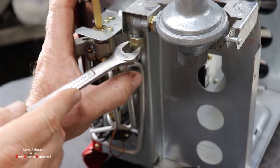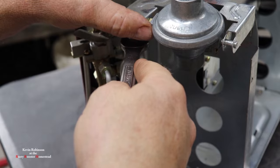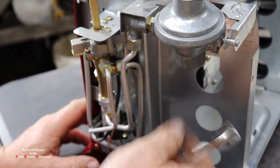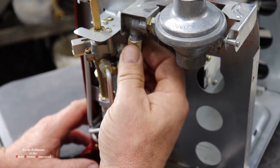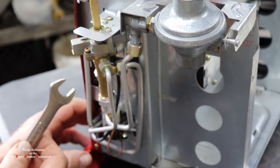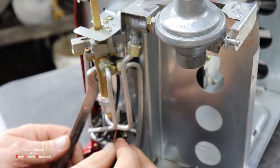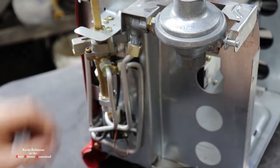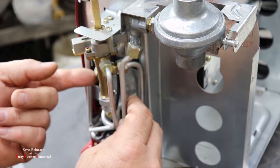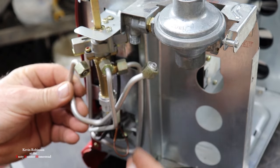What we're going to do is take a 14mm wrench — I didn't mention this at the beginning, but you're going to need one. We're going to get this loosened up. We don't want to be cross-threading anything or go crazy on this machine. We got that one loosened. Now we're going to do this other side — be careful with this. If you get it broke loose, you won't have any problems twisting it off with your fingers. Now that we've got that off of there, all we have to do is fish it right out the hole.